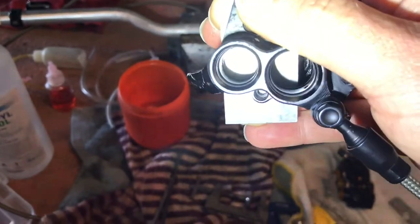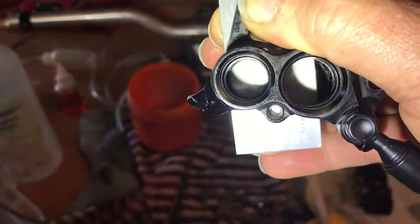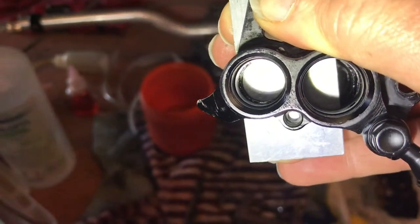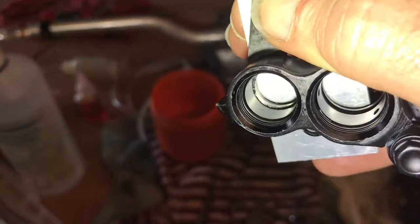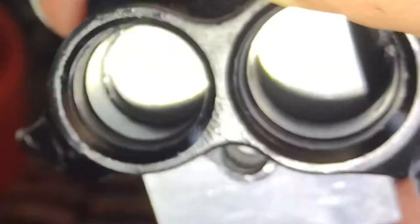On the ball side, the easiest way I found to put the seals back in after covering them in rubber silicone is to put a piece of alloy on the back - which I used to press the pistons - and you push the seal right down against that, and then it can pop out the other end every time. Then you can just seat it with this tool - very easy to do that way.